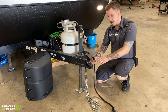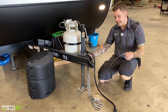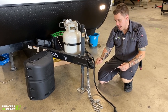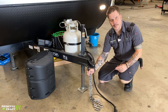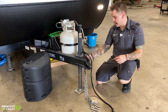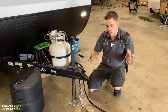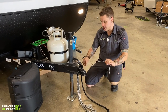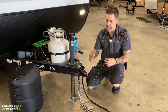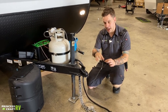Riding right next to those tow chains is going to be an emergency breakaway cable. This is a very important piece of safety equipment — this is essentially your last safety in line. So if your coupler were to fail here, that tongue slammed down on those tow chains, broke those chains, as those two vehicles separate, this is going to act like a ripcord to the electric brake system, essentially pulling the plug back here, putting full 12 volts to those brakes. What you're avoiding with this is going to be a runaway trailer situation. So very important that this has its own separate connection point on the receiver, whether that be a carabiner, quick link, whatever — as long as this is connected separate of the tow chains to the receiver, you're going to be in good shape.